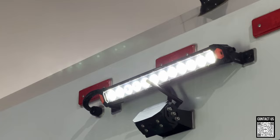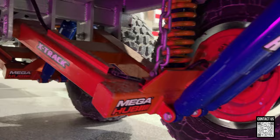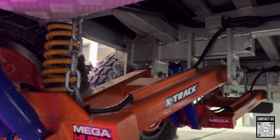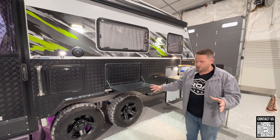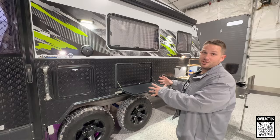You have four wheels on the ground, plus a backup camera. Speaking of suspension — you have an independent A-arm suspension with gas shocks and huge reservoirs with lots of oil for those washboards, plus a mega hub with 12-inch brakes. They also have the tough tracks with camber settings where you can adjust the camber and alignment pretty easily. They've really gone into a lot of effort to make a suspension that's one of the best out there on the market.